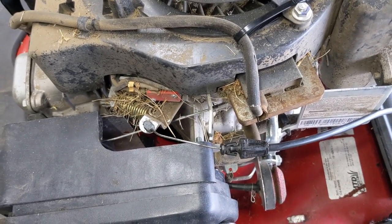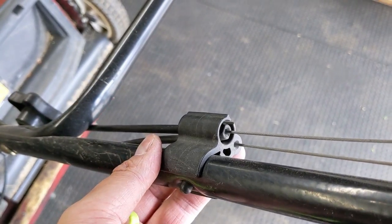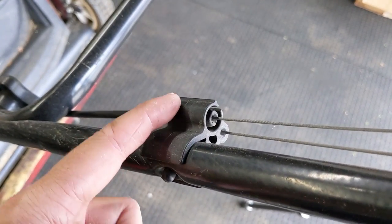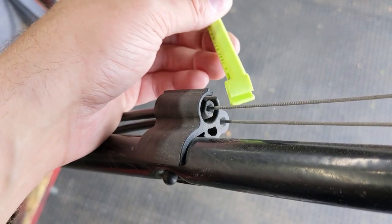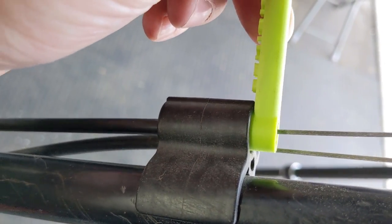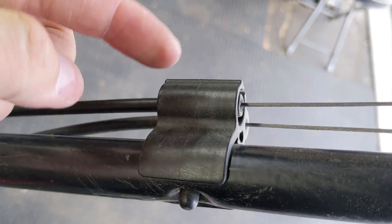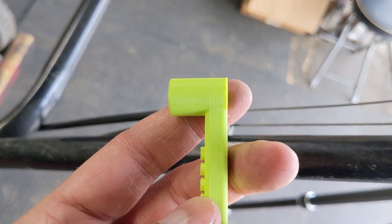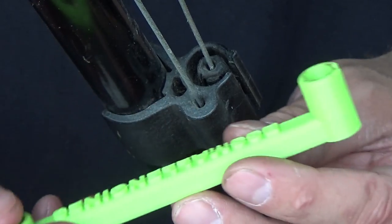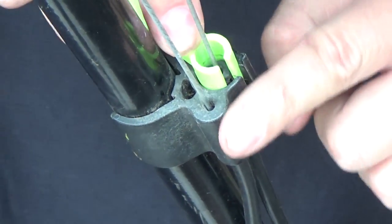But if we go up to the handlebars, we're not going to have as much room. This is a self-propel mower, and on this particular one it has the main control cable that engages your flywheel brake and kill switch, but it also has the drive cable. They utilize this piece of plastic with a dual cable connector. The main issue is when you try to fit the small edge down here — because of how short that piece is, it just doesn't fit down far enough to depress those two tabs holding the cable conduit in the bracket. So Brandon made the 2.0 version with this longer piece on this end, and we're going to be using the long side now.